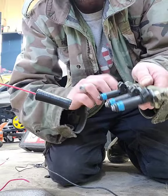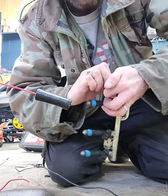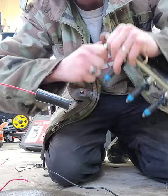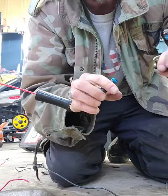Fuel injectors, pretty simple. You usually twist them to turn them around 180 degrees. You get a little retainer clip. The retainer clip pops off, usually pretty simple. And then the injector itself, give it a little wiggle and pull, and it comes right out.